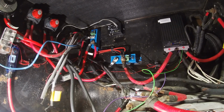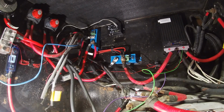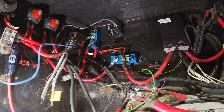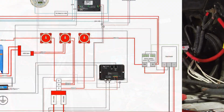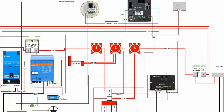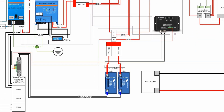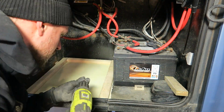And in this case, I actually mounted this in reverse to be able to handle the charging. I also mounted my DC-DC buck boost through this BatteryProtect. Then I ran the wires up to a cutoff switch and then directly to the battery bank. So now to the battery compartment.